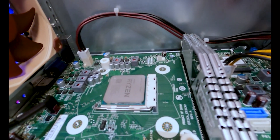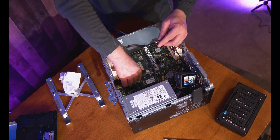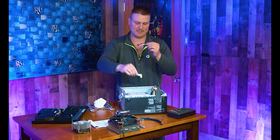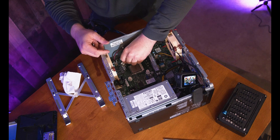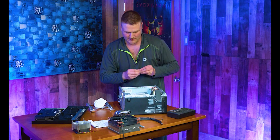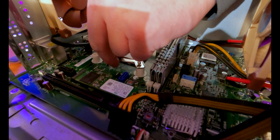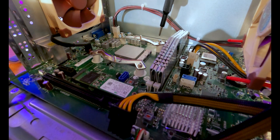Make sure the bracket is facing outward. The one on the top of the case goes this way, and the one on the bottom goes the other way — install them like that. Go for the middle hole on both brackets, as there are three different holes available. The screws are Allen heads but also work with the Torx bits in your kit. Get them on there hand-tight, then secure the rest of the way with a screwdriver. Before securing both sides down, make sure both are threaded in.